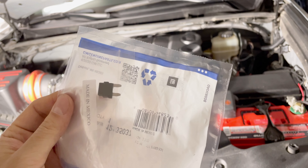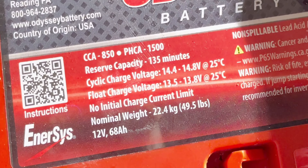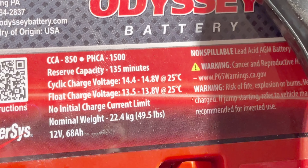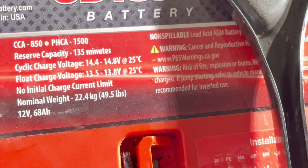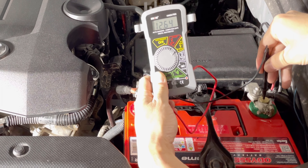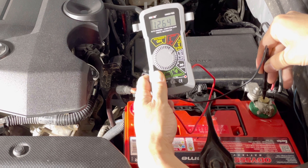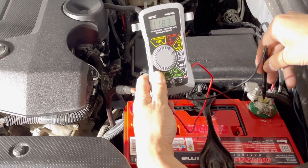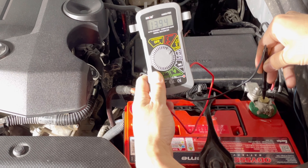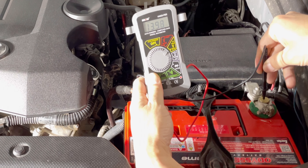I have upgraded to a stronger battery, which is an AGM battery. It needs a cyclic charge voltage of 14.4 to 14.8 volts, but the 4Runner doesn't deliver that. The 4Runner's alternator delivers between 13.5 and 14.0 volts. When the battery is on standby it's at 12.64 volts, and when the engine is on voltage goes up to 14.08 — it doesn't reach the level the AGM battery needs.